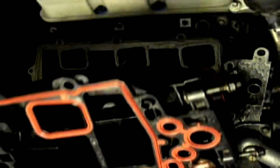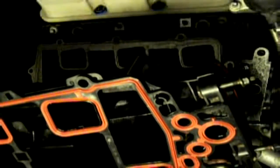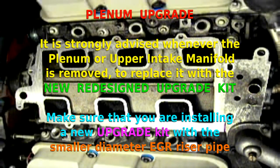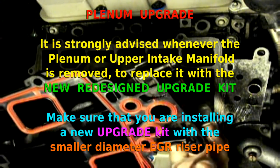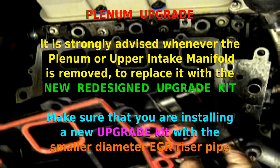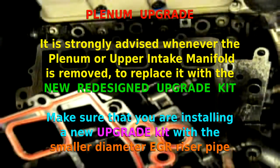That's the capacity — the cylinder or combustion chamber volume of the engine. These engines are normally referred to as the 3800 V6 Series 2 engines. When you check your plenum before you put your gasket on, just make sure that there's no pitting or degradation in this area. If you remove your plenum and you see any kind of degradation or pitting right around this area — it's a tube, the riser that comes from the EGR valve — you may want to be better off getting a new plenum. Many times, that's the best way to go.